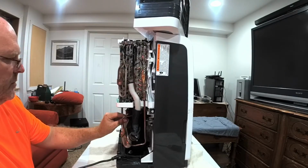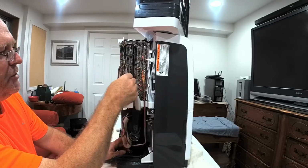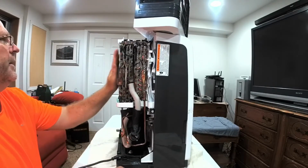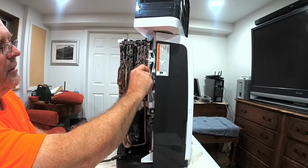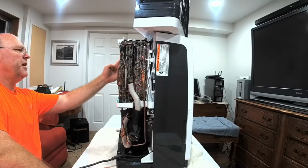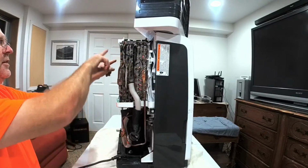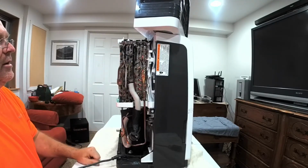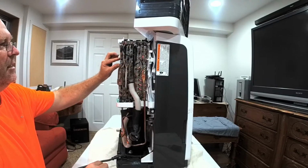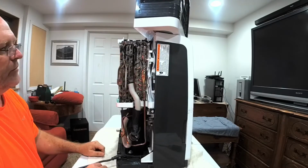I mean, it looks like it's working there just a little bit. Every time you touch it, it kind of thaws it. But where it's low on Freon, it should be getting cold on the other side of these fins, and it's just not. It's going in here and then kind of zigzags in, and usually I was getting the buildup. This whole end would build up with ice across about 5-6 inches just right in here.